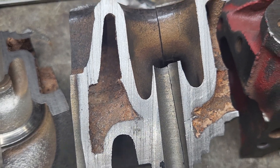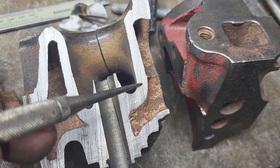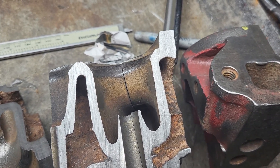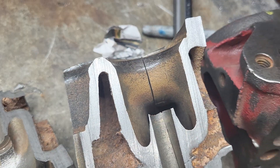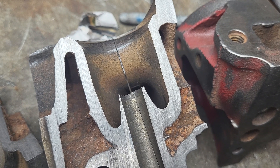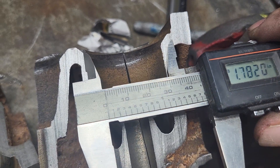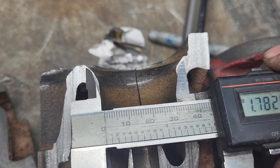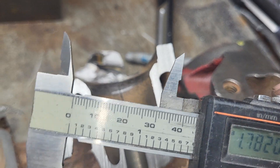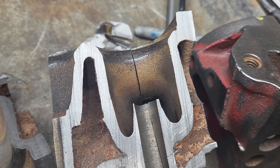You can notice how much metal we have around the bowl. I say you can take about a hundred thousandths off and you're good — that would apply here too. Let me set my calipers to 1.78 — that's how big the valve seat is. Now we're missing a little material from blade thickness. How big do guys open these? I've heard they go to about 208 — let's see what a 202 looks like.